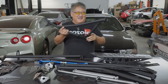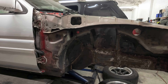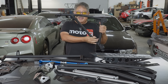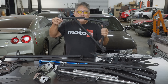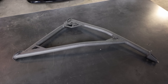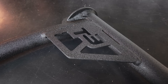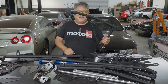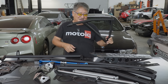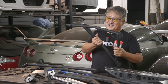The part that will probably make the biggest difference is a brace that runs from the door hinge bolts on the A-pillar — one of the strongest parts of the car — the entire length of that section, then triangulates out and bolts in right by the shock tower. It's a pretty decently sized tube with gussets in the corner. I've used this on a number of other builds — Evo, STI, Z32, R32 — and these things make a huge difference on older cars. T3 makes this, and I recommend it to anyone with an AE86.